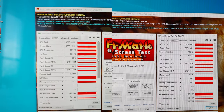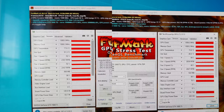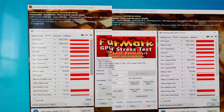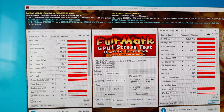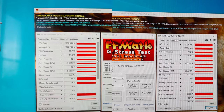With a fresh application of regular GD900 thermal paste, I got 78 degrees on the GPU and 92 hotspot with fans running at 52%. When I switched to the PTM7950, the GPU temperature dropped to 74 degrees and the hotspot to 86 degrees, with fan speed reduced to 48%.